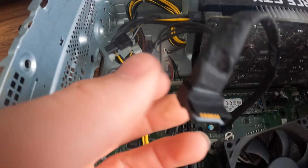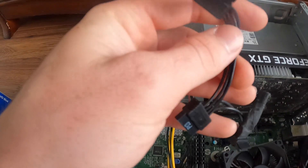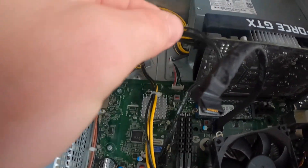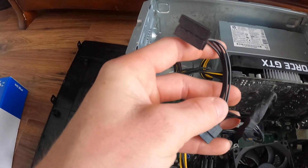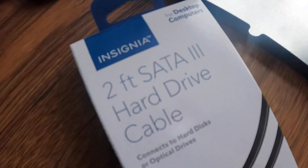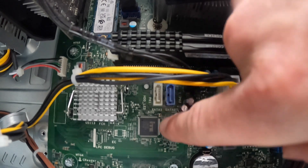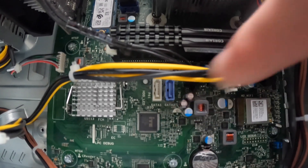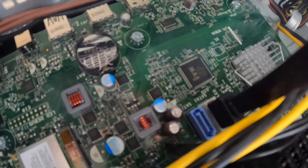If you don't know, this is what your SATA cable looks like and this is what your power cable looks like. Depending on the PC that you have, it may or may not come with two SATA cables, but it should always have two power cables. This is going to be the second hard drive that I'm using. I don't have an extra SATA cable so I bought one just in case. If you look down here, there are two extra SATA cable ports — it says SATA one and SATA two — so we're gonna go ahead and plug in our new SATA cable to port one.